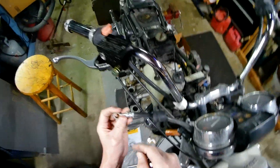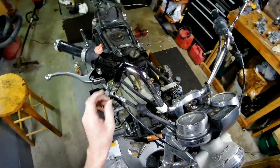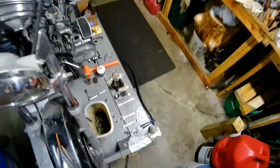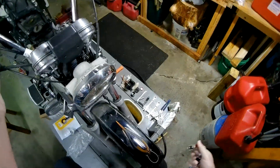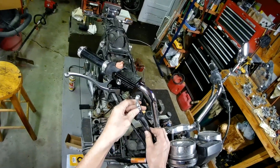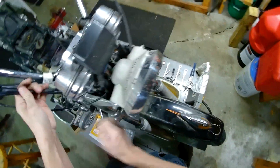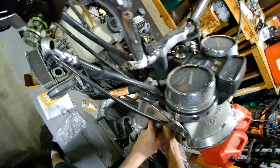You can see this guy was rusty, and you can see inside the actual brake line which has me a little bit worried - like the whole brake line's rusted like that. I might have to swap it out for a different set. For the time being, we're just going to run a little wire brush in there. You see that rust coming out of there. I see how this one's made for the back brake line, so that was the only issue I was worried about - might be able to get a different brake line to fit.